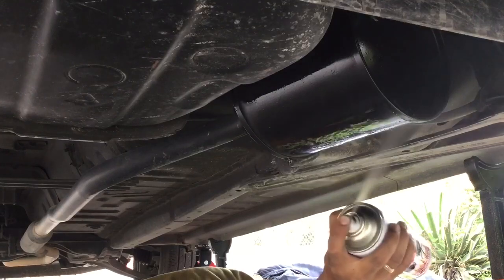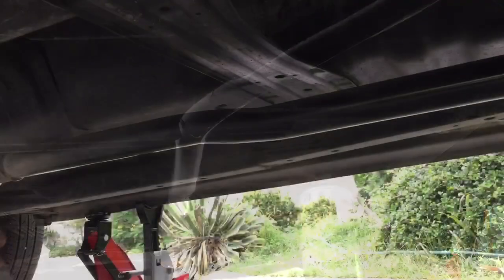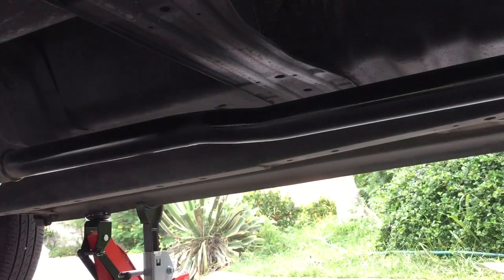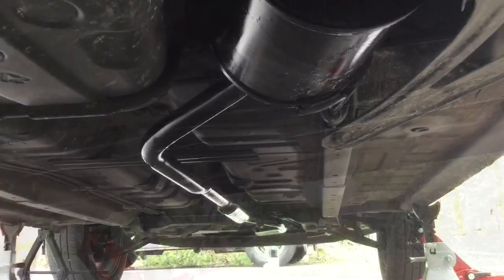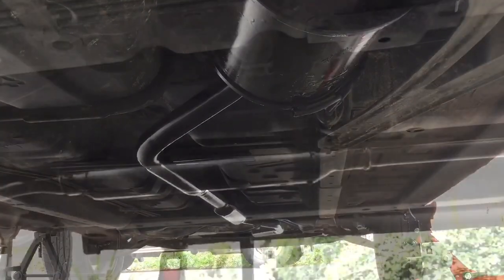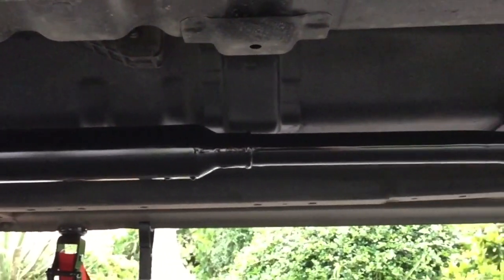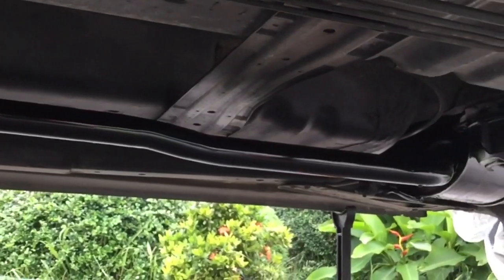The spray paint can should be at least 5 inches away from the pipe. Press the can and move it from left to right and back. Don't forget to overlap the part that you just spray painted and cover everything. So far, we have spray painted the tailpipe, muffler, resonator pipe, and catalytic converter black for at least 3 coats. We'll spray the rest of the exhaust blue.